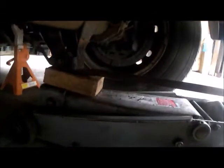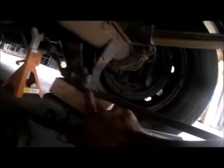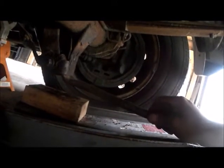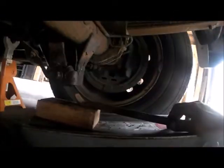Here's what actually worked perfectly: my dad had a little crowbar with a curved end — the kind used for mounting tires on rims. We wedged it in here to keep the shock from sliding backwards while jacking it up. So when you're jacking it up, the crowbar keeps the shock pushed forward, giving you enough room to get that bolt right through. That went on just like butter. I'll tighten everything up now.